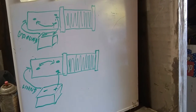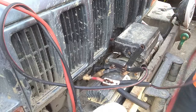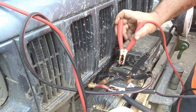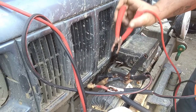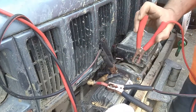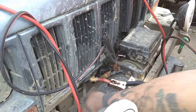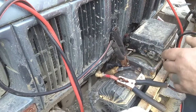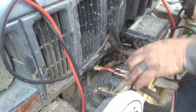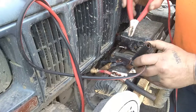So follow me and we'll show you how it's done. Alright guys, so we're completely bypassing the box right this moment. What we got is the hot wire here ran up to the battery and I'm using my grounds off my jumper cables to connect these two posts. If I go with this side, it'll spool in one way. If I switch these around, put this one on the back one and connect this one — remember, I already have a good ground hooked up in here. So if I had it on a bench, I'd want to make sure that I ran this ground over to my battery as well, and then connect these two and then run my hot. What this does, though, is it tells you that the motor's still good.